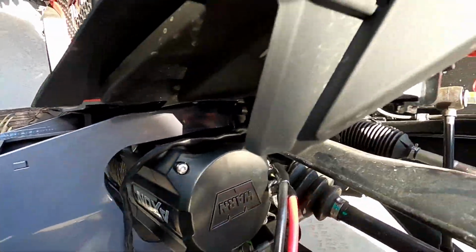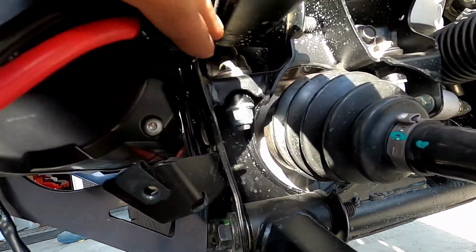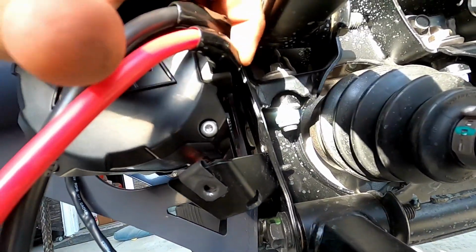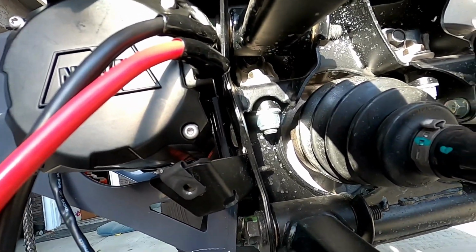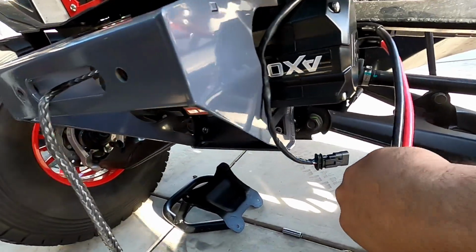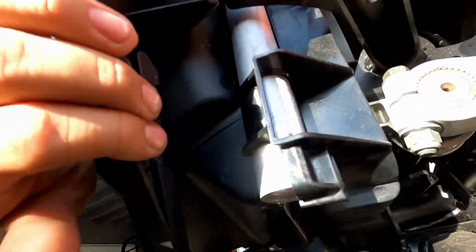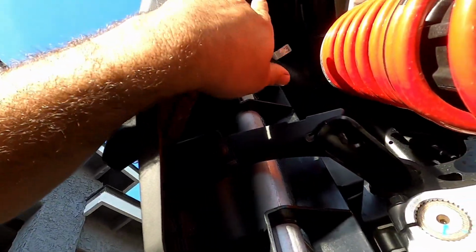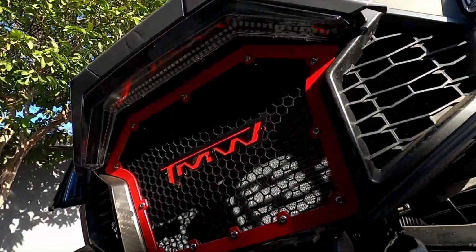All right guys, at this point I wanted to show you how I did the wiring. Now the wiring is very close to the line of the arm, but we'll avoid it just fine. It's kind of just stick it up a lot more because it has these boots that go over the terminal ends. I'm going to route it upwards like this and maybe follow the line up here in between the radiator and the front fascia, and then up towards the top where the wiring starts coming out for the headlamps, and then follow that wiring into the machine's cabin.